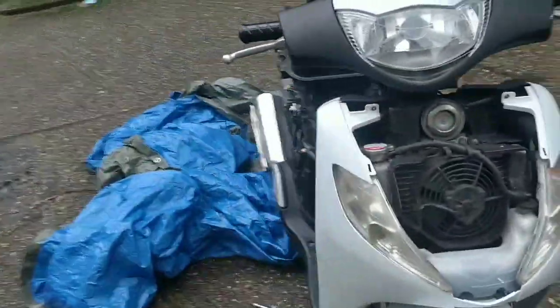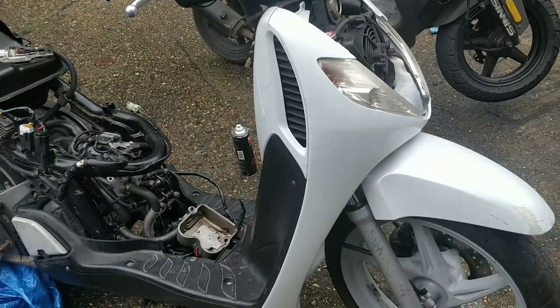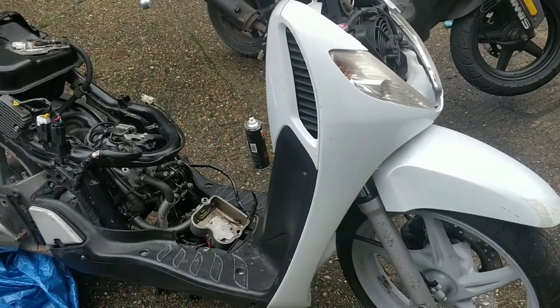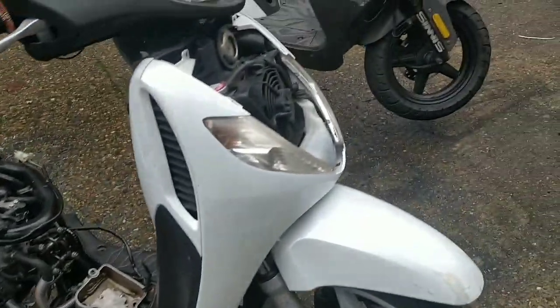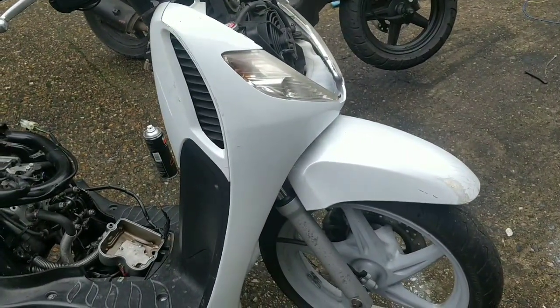I think maybe the engine build didn't go as well as I thought it did. That's a possibility. I've tried every timing thing there is, and can't seem to get it to fire up, yet it ran beautifully beforehand. So that's a tough one. I'm dead set that the piston and rings are fine. I'm dead set there's a problem with timing.